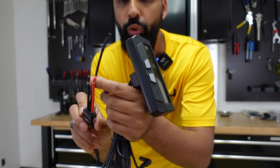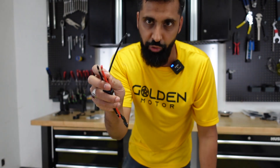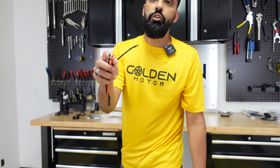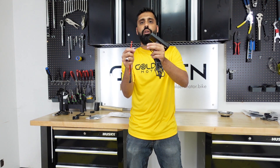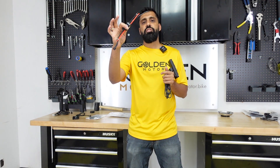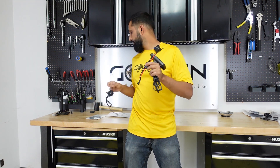On the controller side there is a signal wire — a green signal wire. Basically you are transferring the shunt signal wire from that side to any controller and then the throttle will work. So after you install the shunt, which goes from your battery to your controller, you just plug in the Cycle Analyst throttle and the Cycle Analyst.